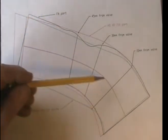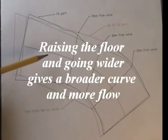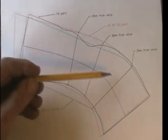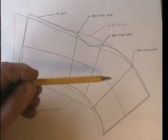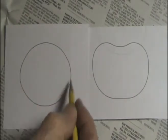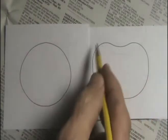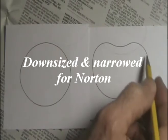If we had a longer intake valve and a steeper port we could get by with a round port, but because of this curve we need an oval shape — what I call the cobra head. It's wider in the middle, especially around the guide and in the upper section of the port. This gives us more efficiency than a round port. This is a cross section of a full auto intake port near the guide — you can see it's oval shaped and the floor has been raised. This is a cross section of a Harley XR 750 intake port near the guide — you can see the port has been raised high on the sides near the guide and the floor has been raised as well.